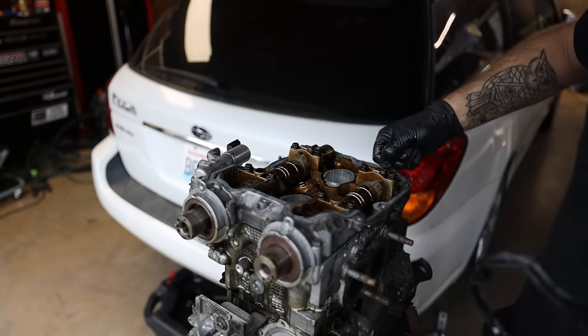All right, you guys, so when it comes to installing the rear main seal with this tool, you don't wanna do one bolt all the way in and then another bolt all the way in. You wanna do even pressure as you go around this. So I'm gonna start on the bottom because I know I got the top in a decent way. I'm gonna get everything snugged up to start with. Yeah, that's beautiful. That looks so good. Dude, Company 23 for the win, man.